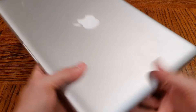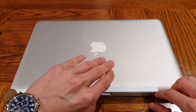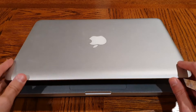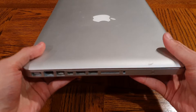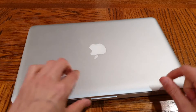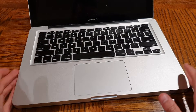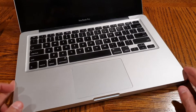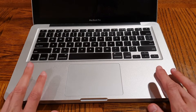It's got an i5 but it's only got four gigabytes of RAM. Basically this is my brother's laptop and he has a newer MacBook that he uses as his everyday thing. But he coaches high school football and he wanted a computer he could just leave in his office — he didn't care if it had to be plugged in, it's literally going to sit on his desk. He said he had this thing sitting around, can you do anything with it? He said it turns on but it's super slow. He thought maybe he had a virus, but I said you're probably running a mechanical hard drive and with only four gigabytes of RAM you're pretty limited, especially by today's standards.